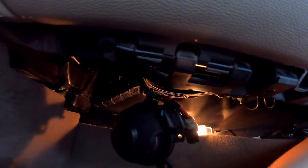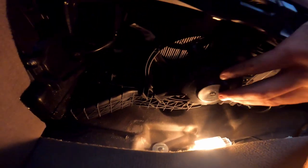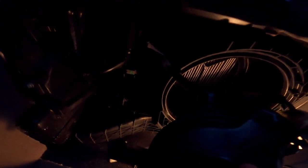To find your resistor, you find the blower motor — I have a video on removing that as well. The resistor is right here. There's a bolt right there — it is a 7/32nd screw — and then there is one on top. Once we get those out, this should pull straight out and we can drop it out and swap it. First I'm gonna pull that gray plug off.